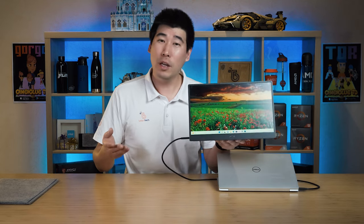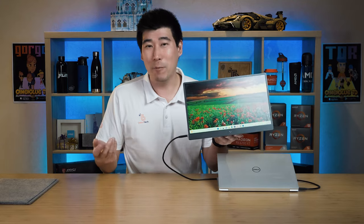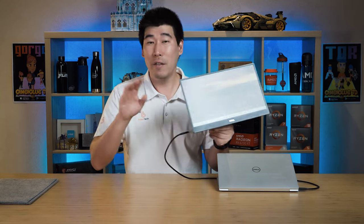If you have a 65-watt power adapter connected to the portable monitor, it will only pass through 45 watts to the computer. With a 45-watt adapter, it only passes through 30 watts. So the monitor uses around 10 to 15 watts to power the display itself. It's still nice to have pass-through power. However, these USB Type-C ports do not support USB data — so if you plug in a USB flash drive, it will not be recognized. They are only used for pass-through power.